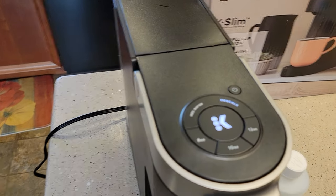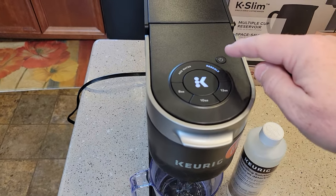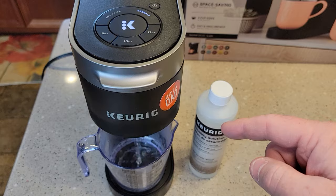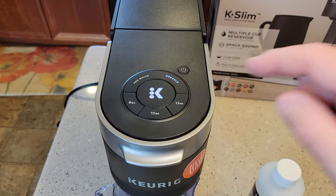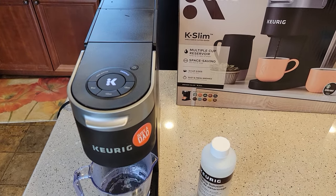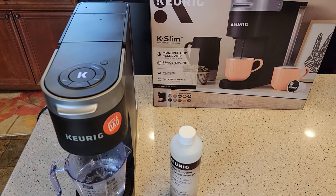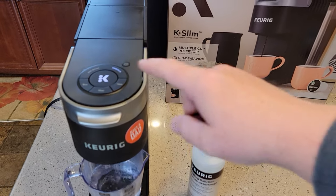Your descale light should go out. If your descale light doesn't go out, unplug the machine for about 30 seconds and then plug it back in and power it on — it should go out. Now, if your descale light was on because you actually needed descaling and this didn't work, it says to buy another bottle of Keurig solution and do a whole other descale. So it's kind of important to keep up on descaling — doing it every time the light comes on might mean it's building up too much on the inside. They do recommend you do this about every three to six months, depending on how hard your water is. If you've got really hard water, your shower head will have a bunch of lime on it — that means you've got pretty hard water and you probably should be doing this every three months.